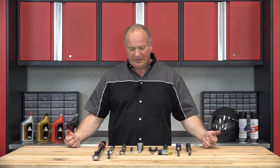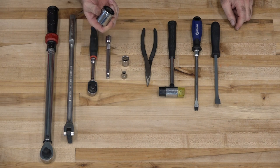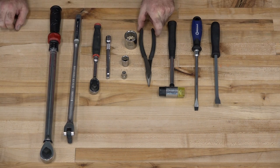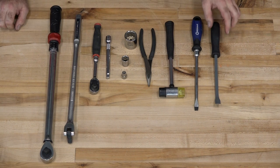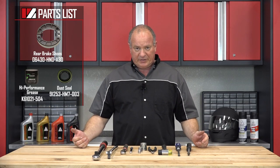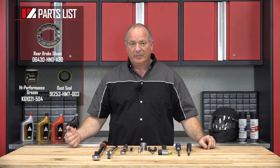This is going to be a skill level 2, but just barely a 2, so don't be afraid of this. Let's go over some of the tools you're going to need: basically an 8, a 17, and a 30mm socket, a decent ratchet, breaker bar possibly, a big torque wrench, a good pair of pliers, a dead-blow hammer, and a couple of pry bars or a large screwdriver. Reference our parts diagrams because this will show you exactly how things come apart and, more importantly, how they go back together, and it's going to give you the part numbers you'll need to rebuild.